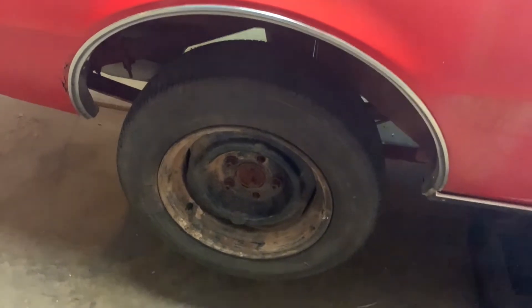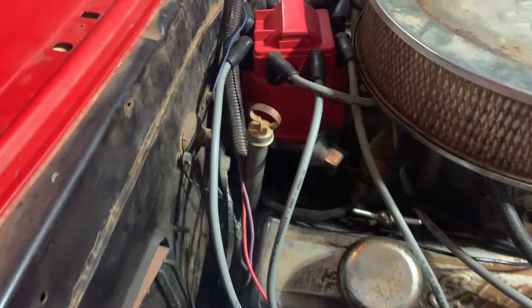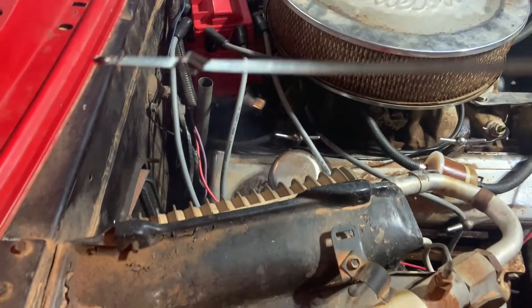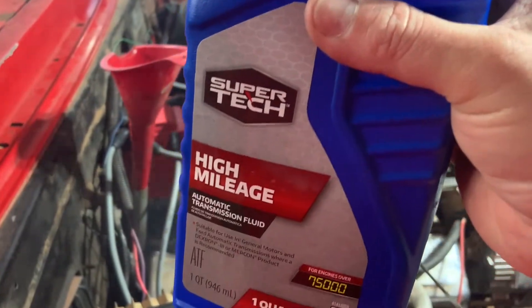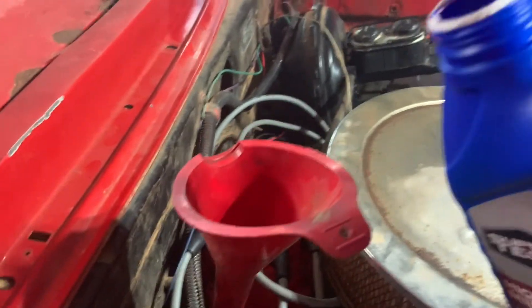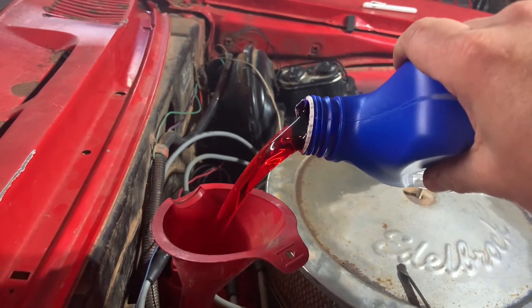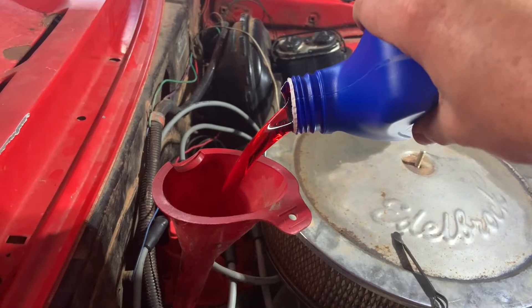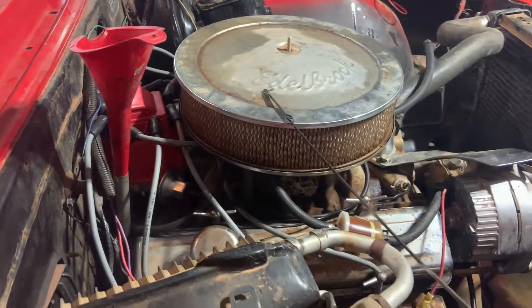Well, the transmission is not moving the wheels — no movement. Maybe we should recheck the transmission fluid. We did it a couple weeks ago and it was full, so let's see what it looks like today. The car is up to temp, it's been running about 10 minutes. Sure enough, we are about a quart low, maybe more. Let's grab some ATF and throw this into the transmission — picked up some cheap high-mileage stuff. Let's pour this in. A quart will hopefully do it — we'll find out in a minute. First thing I'd do if your automatic car is not moving: check your transmission fluid.